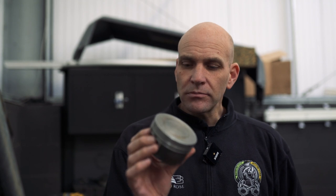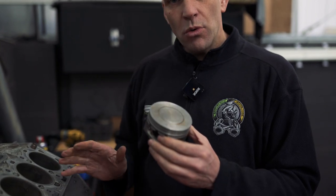This is a V12 piston. The liner distorts — no one really knows for sure why. Without machining out the liner and measuring the parent bore very accurately, we can't know if there's distortion in the parent bore causing distortion in the liner, or if the ovality is purely in the liner itself. It's quite a complex measurement process, and in our world we just repair what we see in front of us, which is a liner that's worn oval.